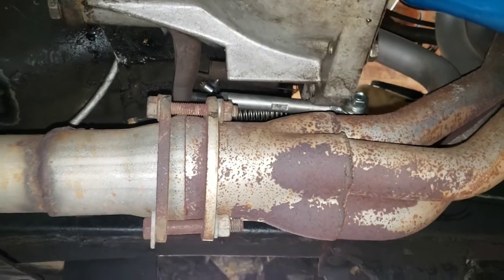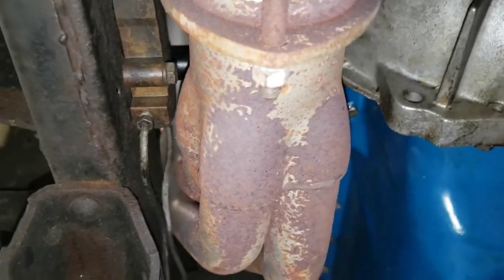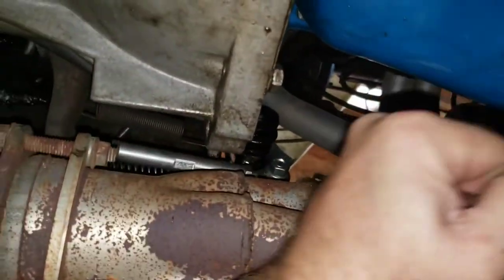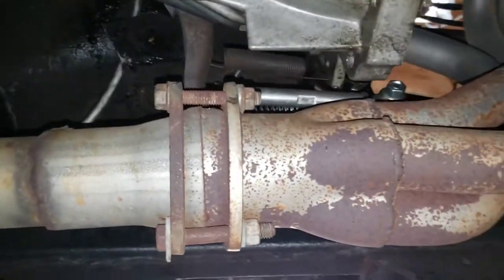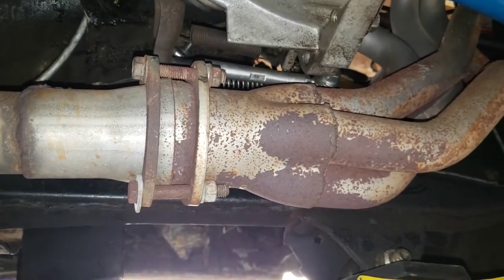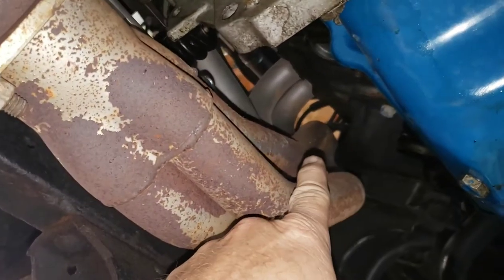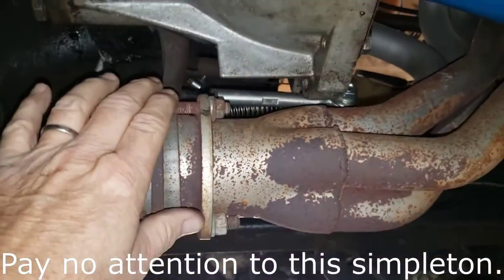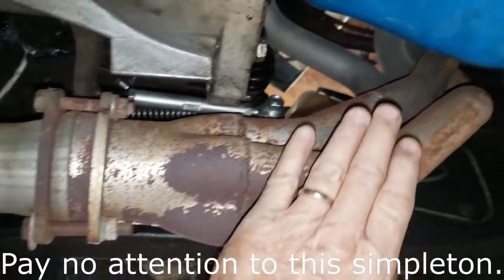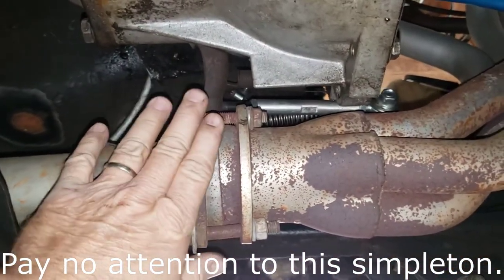Alright, I think we found the source of our little rattle. That's the one I'm hearing right there — when you crank the engine, that thing sounds like a rod knock. It sounds really bad, but I think probably it's just these bolts need to be tightened up a little bit. So that is of no concern to me. I wanted to find out what that was before I started because it was just bugging the dickens out of me. So up next, let's go ahead and replace the header gasket — the leak is on this side of the engine. I think we just need to loosen this and give ourselves some play in the header, then go up top and replace the gasket, and then come back here and tighten this up to make sure our rattle is gone.